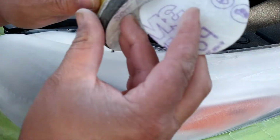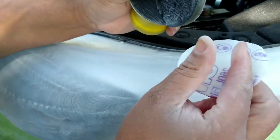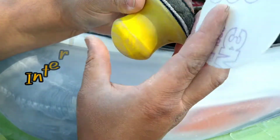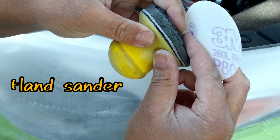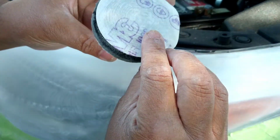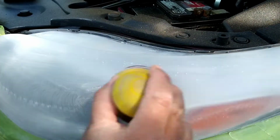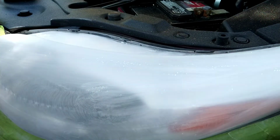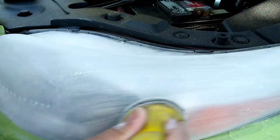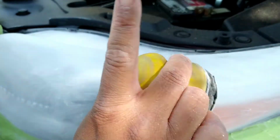I've had a couple guys say, "Oh, what do I do?" Or they've contacted me asking how do I keep the dust from flying into the light, or why do I have orange peel in the light? It's because you're not keeping a sterile work environment. Once I blow all this stuff away, I even go over it between steps with towels, and in some cases a wet towel, or the towel I use after the Windex stage. As a rule of thumb, I go out about 3 feet around the headlight, and always make sure to blow out the engine bay. So if there's a gust of wind that you don't even feel, because 9 times out of 10 you won't even feel it, it takes a very light gust of wind to feel it.